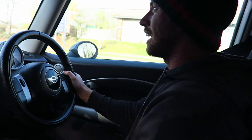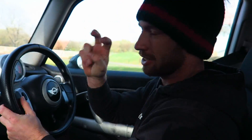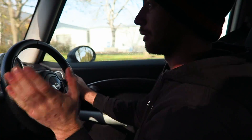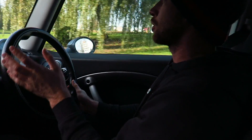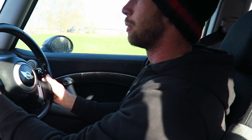So we're in the Mini, and the last thing I did with the Mini was we rebuilt the engine. It's still actually running tap water. I planned to have tap water in it for a day, because it's obviously not good to put tap water in your engine - it's got a load of iron and chemicals in it. So it's not good for the metals in the engine. But anyway, it's been in for about a month. So we've finally got some coolant and we're going to empty the water and put the coolant in.